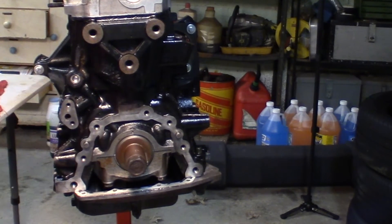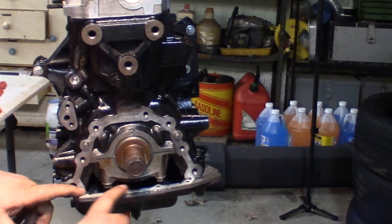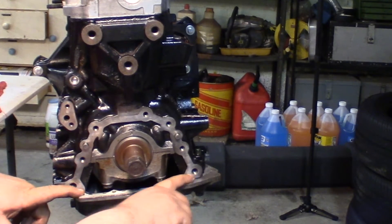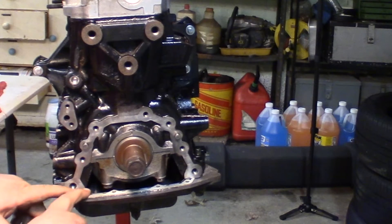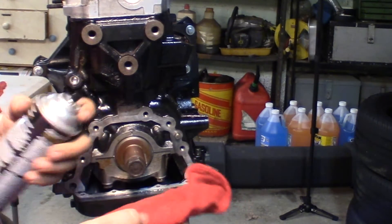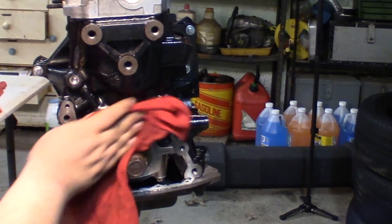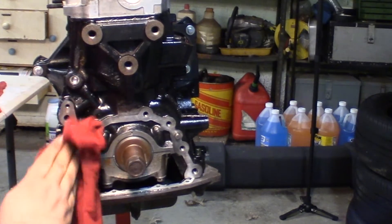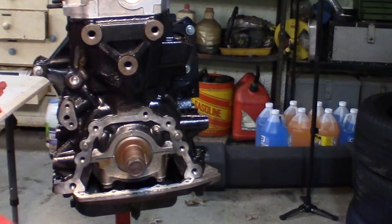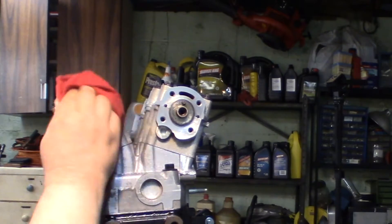So we're just going to start by making sure we're going to get our gaskets and everything in place for this timing cover. The oil pan's already been installed here, so there's a gasket — part of that oil pan gasket — that seals the bottom of this, so we don't have to put a gasket there. What I like to do is just get a little bit of brake clean and a shop towel and just make sure that my gasket surfaces are all nice and clean and dirt and residue free, and then we're also going to clean off these surfaces up here where the gaskets go around these cam towers.